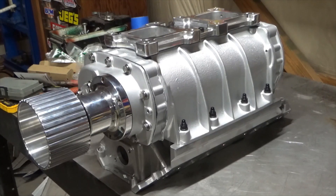Here's the blower I'm gonna be using — this is a 6-71 GMC blower. This actually was originally on a diesel engine; I bought it and converted it over to gas, and I'm gonna be running it on this big block. You're probably wondering why the pulley is on backwards. The reason is if I run that length snout on the blower, I can flip the pulley around and with a spacer I can run it either on a small block or a big block. I was thinking for the future, just in case this blower ever goes on a small block, I won't have to keep buying a different length snout. And I actually kind of like the look of the pulley being backwards — I think it looks cool, so I'm gonna run it that way.